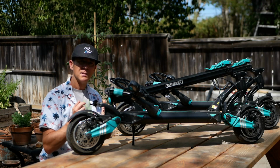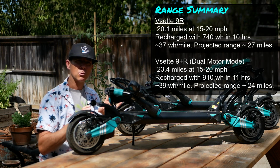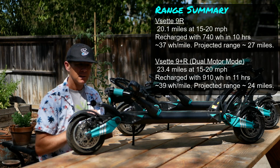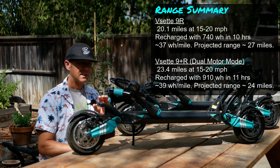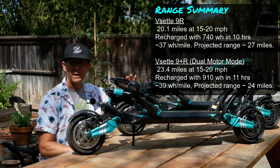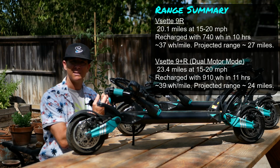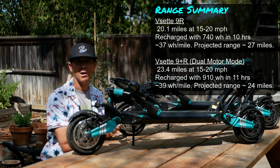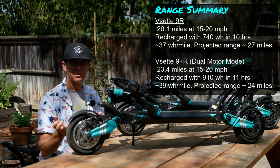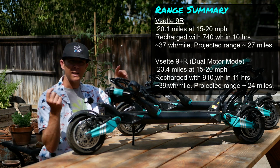Range wise, in the mid 20-mile range is what I got, and I was riding it somewhere between 15 and 20 miles per hour most of the time. I did not do a range test in single motor mode on the 9+R. I found in the past that because of the resistance from that front motor when it's not running, you don't tend to get a lot more efficiency in single motor mode. If I get an opportunity to test it in single motor mode, I will put that down in the description.